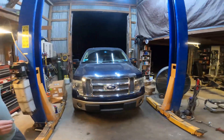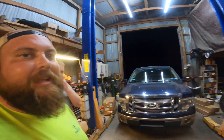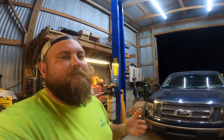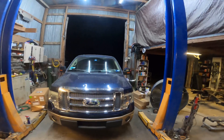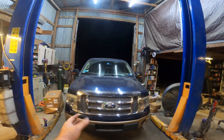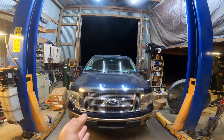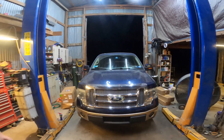The only important things to note that we skipped over: one, it takes a minute for the computer to learn, so you just got to drive it around. If you don't have a scanner to watch the evap temperature and see how it's adjusting, you just do it by feel — small increments at a time. If at any point you happen to freeze up your lines, just make sure you kill everything. The computer will sense the pressure buildup and turn everything off anyway, but to be safe, kill everything if you see freezing temperatures and then adjust accordingly. There's just a lot of play, a lot of test driving, but you can tune it in very, very good.